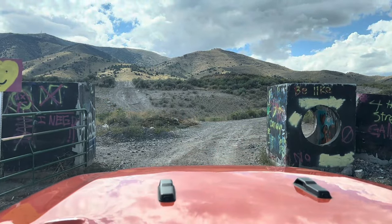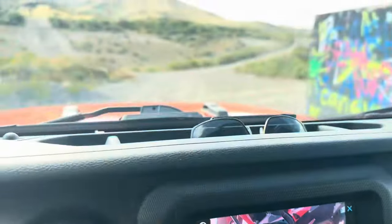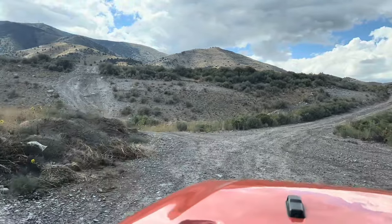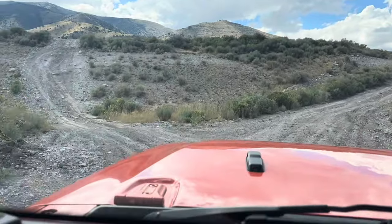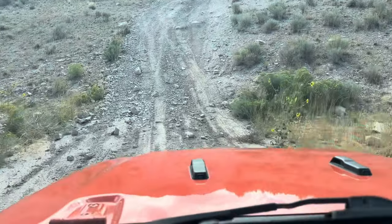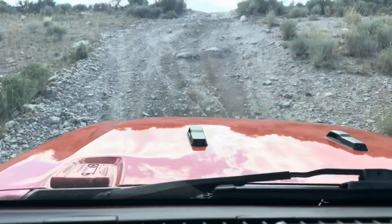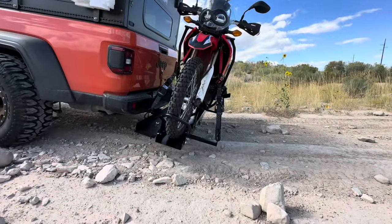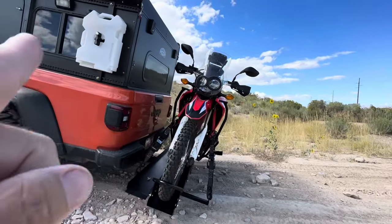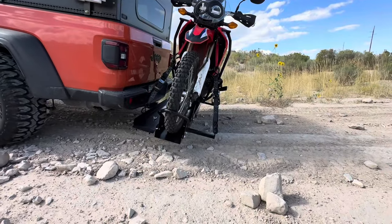If you're going to off-road with this rack on your overlander like I want to with mine, we're going to check a few things out. I've got the rear-view camera so I can see how it's hanging on back there — and that looks fine. Mainly when you're making climbs, you need to be concerned about the angle of departure for your rear end. The angle of approach at the front doesn't change, but at the back you now have that hanging out of the back of your vehicle and that's definitely going to affect things. If you hit these back bars on the ground, they're going to push that up, possibly bending those bars, allowing your bike to go into the back of your EDC Harker Outdoors Camper. So you do need to be careful overlanding or off-roading with this on your vehicle.